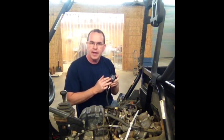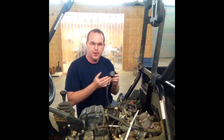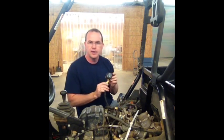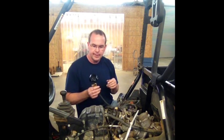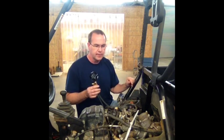One Brute Force I had here, it was fine at idling low speed, but as I started picking up, it started dropping and got down to about 35 PSI. Put a new fuel pump in it, and away it went, everything went lovely.